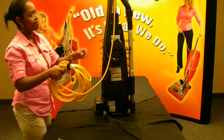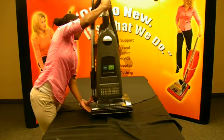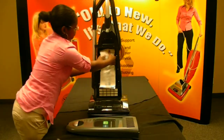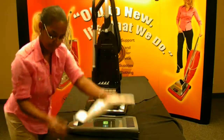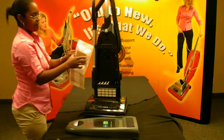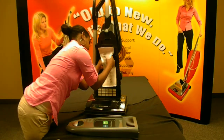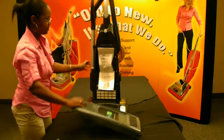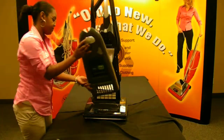Now, facing the front of the vacuum cleaner, we're going to start changing the bag. Lift the silver handle located at the top. Remove the front cover and remove the full bag. Replace with a new bag. Never reuse an old bag — the pores in the bag are clogged with dirt, debris, and fine dust particles, and this will cause the motor to work harder to pick up debris. Replace the front cover.